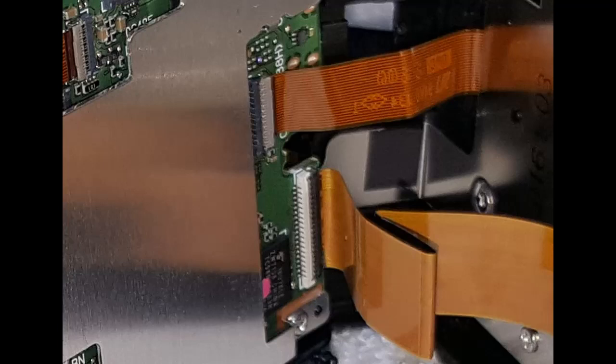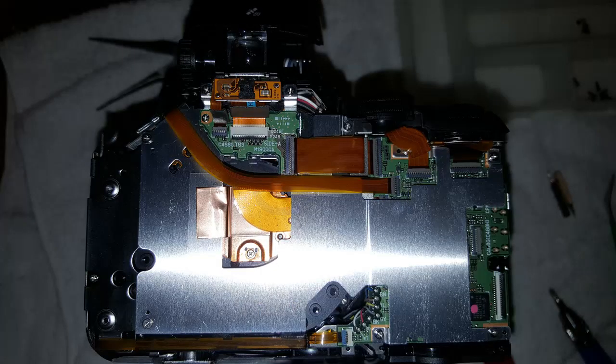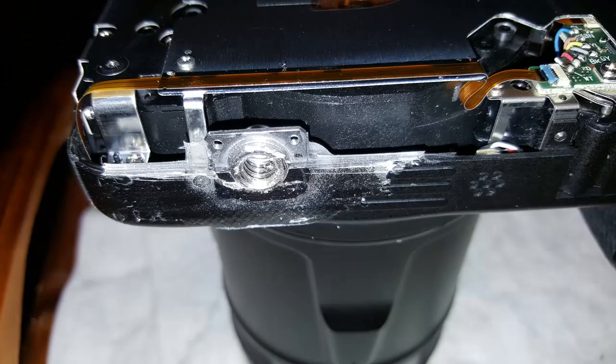Now to remove the aluminium plate, you disconnect the small FFC at the bottom and gently peel it off the plate. Then you disconnect the three other FFC leads at the top. Pull out the three little screws that hold on the viewfinder, then remove the two screws on the left and five screws on the right. The plate should be able to lift up now, and you should be able to remove the plate along with the GPS and the Wi-Fi module on the left hand side.